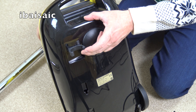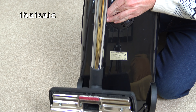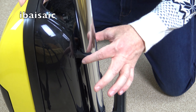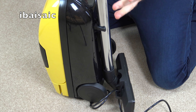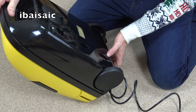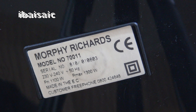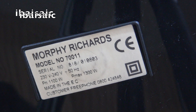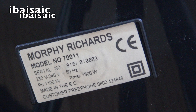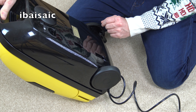There's a little spring-loaded clip that comes out and holds the wand when you park it — it goes on the lower part. You can see when you park it that little clip helps secure the wand, and when you take the wand off it automatically goes back flush with the bottom of the cleaner. The label reads: Morphy Richards model number 70011, serial number 818/010803, 230–240 volts, 50 Hz, PN 1100 watts, P max 1300 watts, made in the EC.